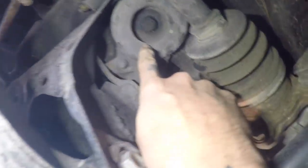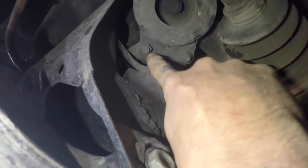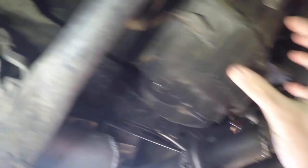Lastly, directly above the axle boot there's a nut on either side and a couple of little lock nuts. With the diff on a jack stand — preferably with a piece of wood between it — slowly drop those nuts off of both sides, then lower the diff out of the way on a jack and roll it out.